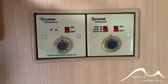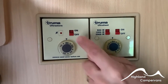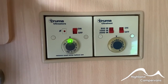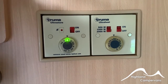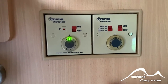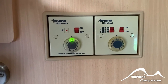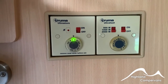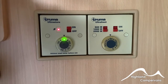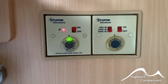If you're going to use the water heater on gas then with the 12 volt supply switched on, make sure the cover has been removed as the label suggests, push up on the on-switch and you should see a little green light come on. You may well hear a click from underneath the bed box as the gas burner lights. If it ignites okay you'll see a green light stay on — if it fails to ignite, perhaps because you've left the cover on the outside, you'll see a red warning light. You can use both the electric and gas systems together if you're urgent to heat the water up.